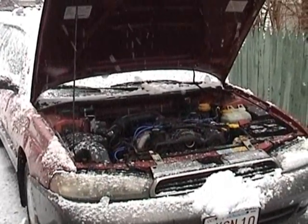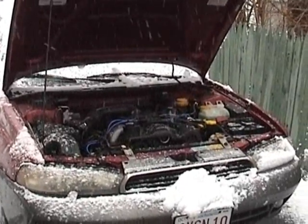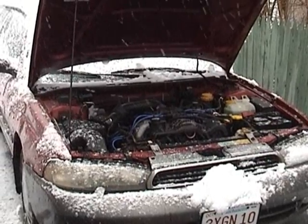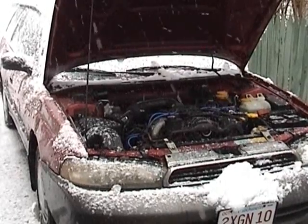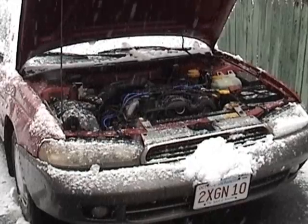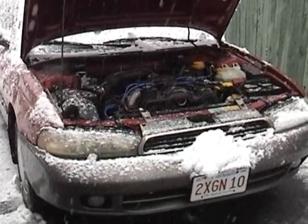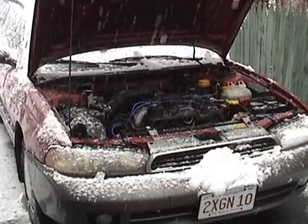I did some research and I don't think it's a hydraulic problem inside the transmission or a problem with the clutches, so I went into the factory wiring and I started to suspect vehicle speed sensor two. There are two vehicle speed sensors, both on the transmission — one further down requiring you to get underneath the car, and one closer up top. All of those things together suggested a possible fault with vehicle speed sensor two. I don't know if it was completely worn out or just on its way out, but either way it certainly was an issue.